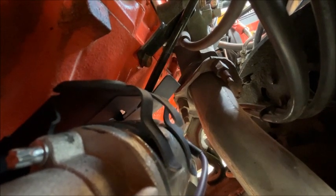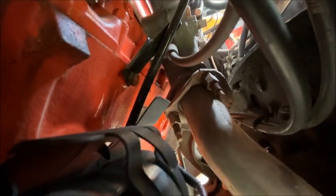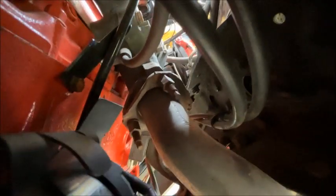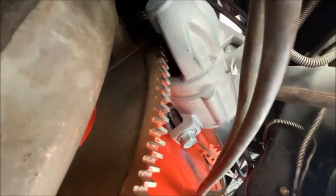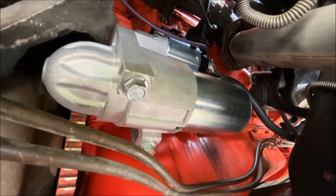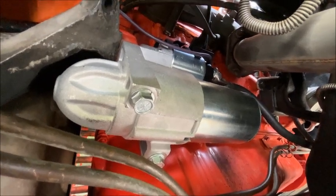Looks pretty good. The heat shield — I tried it in basically two different positions, and the one that worked was this orientation. I tried moving it clockwise as you're looking at it, but that tab on the very end was almost up against the exhaust pipe. I think that's probably how it's supposed to go — it'll keep some heat from the head off there. I think my main problem was just this downpipe running along. I didn't use the shim; I bolted it on and everything worked nice. No problems with noise. Matter of fact, this thing sounds a lot different than the old starter because of that gear reduction — it's got a very sophisticated sound compared to the original.